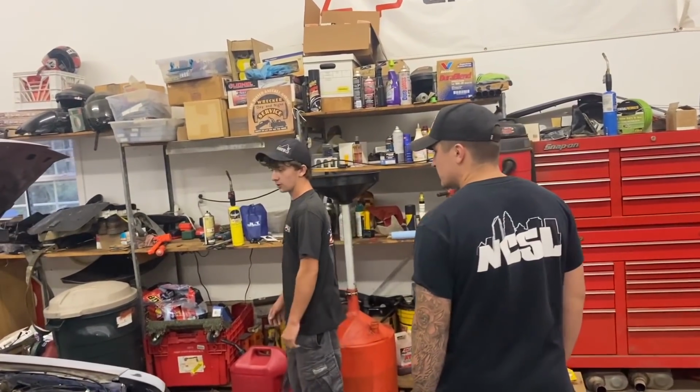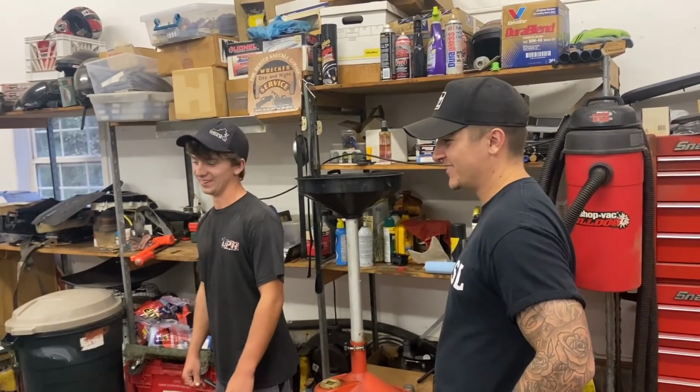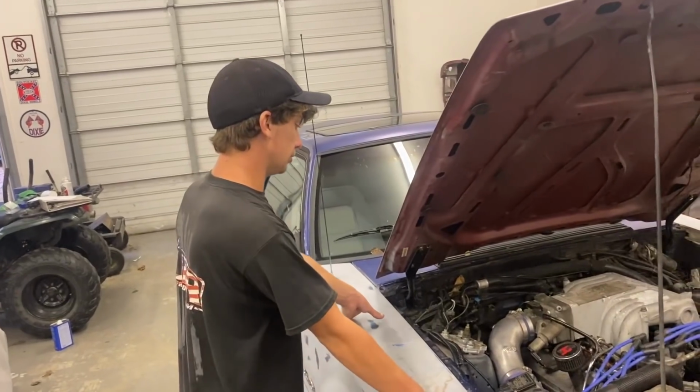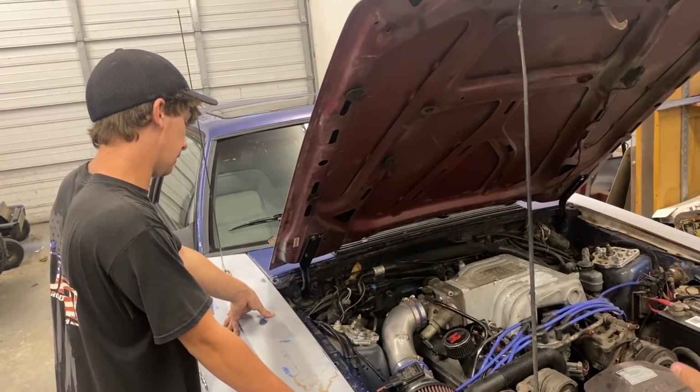88 LX 5-liter car. It's been converted to mass air. It's got 290,000 miles on it. If your car's a 5-speed car, you can basically use any computer you want. You can use A9L, A9P, A3M, X3Z.